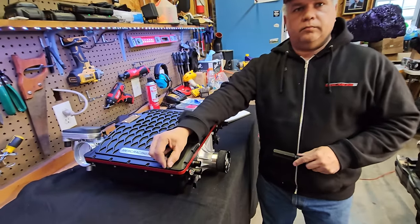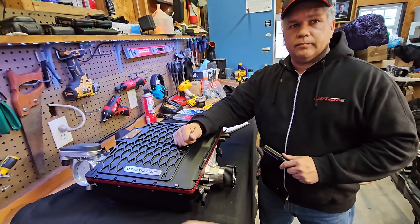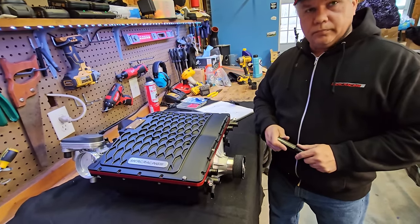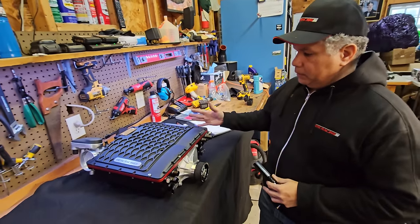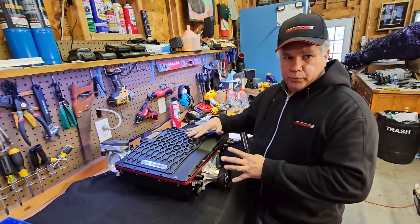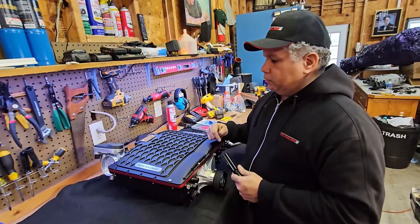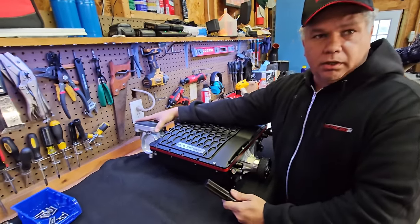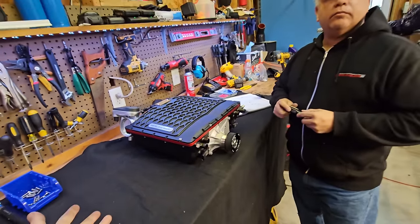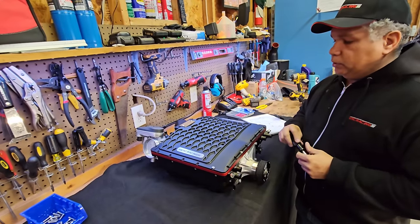When the MRA 1900 ships, it comes fully assembled with every bolt in place, basically ready to run — but it has to be partially disassembled to install it on the car. The throttle body does not come with the kit installed — you can use your OEM one for restricted airflow, or buy an upgraded throttle body. It ships with the upgraded throttle body as default. You'll need to remove the center rib section bolts first — these are 50, 45, 40, and 35 millimeter bolts. Use Ziploc bags and label them because the lengths matter: wrong bolt length will penetrate through the blower.